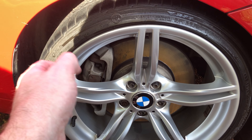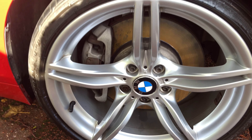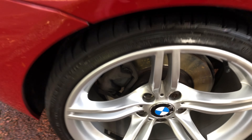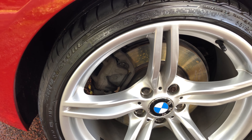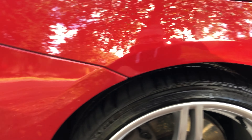Front two tyres are great — you've got plenty of tread. I think about three millimetres is the minimum on both of them. The rears are going to need to be replaced in the next couple of thousand miles. The very inner edge has worn quite a lot. It's an MOT pass — I was told by BMW in Nottingham — but they will need to be done in about another 1,500 miles.